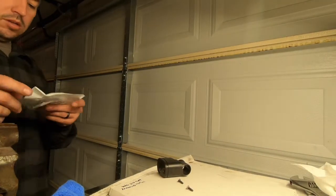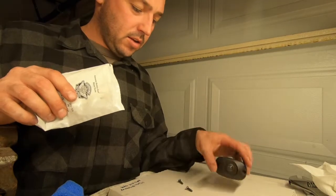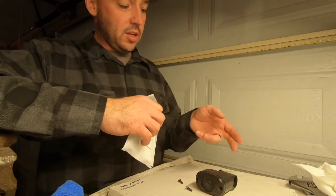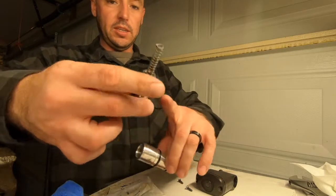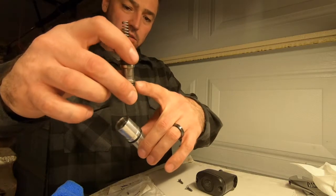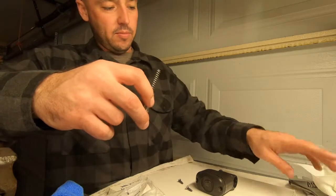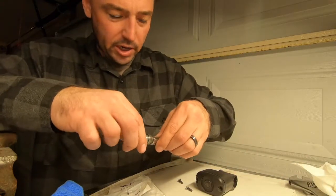This is my rear brake housing. I took the whole thing apart. You can put seals here and new O-rings here — this looks like a seal, these look like O-rings. You could replace those and rebuild it yourself. The only thing that really wears is this ball right here. But I did see some metal shavings in there, so the rebuild kit is the whole assembly — this is all trash now.